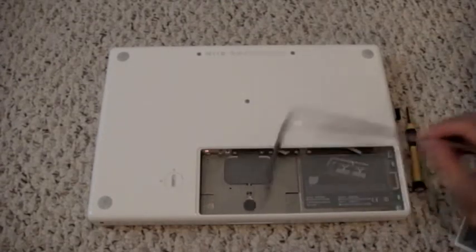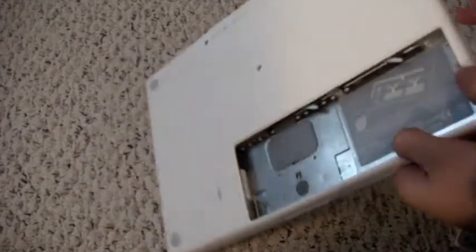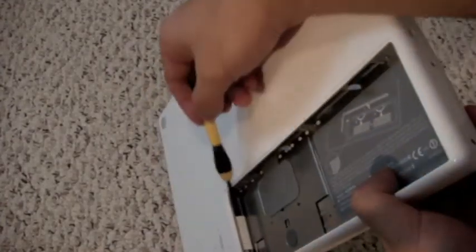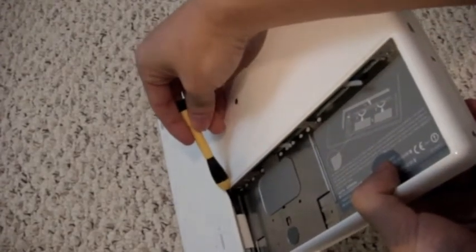Okay, so we can remove this piece. The hard drive is on the left side, right under the battery remove lever. There is a tab we need to pull out in order to get the hard drive out. You might need a screwdriver to pull it out if you can't get it with your fingernail.